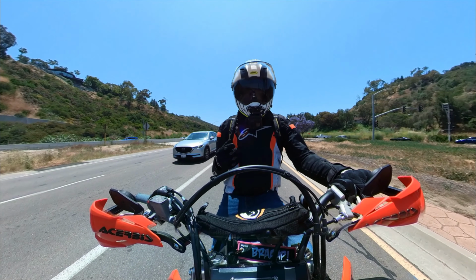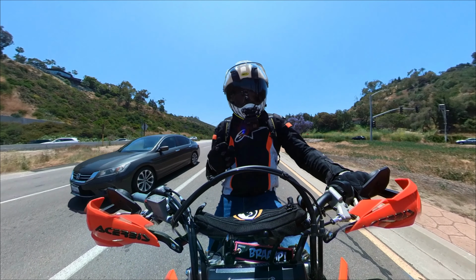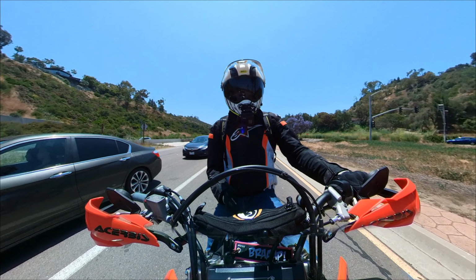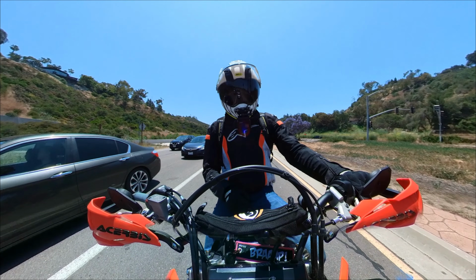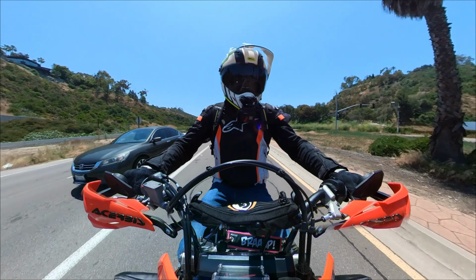And I think the reason why, now that I'm thinking about it, is because it was so stiff that when I would brake really hard, the momentum wasn't really pushing it down all the way, and then it would just kind of give, and then I would finally get the spring action. But this one, the spring action feels a lot more fluid, like it's throughout the entire length of the travel of the fork.